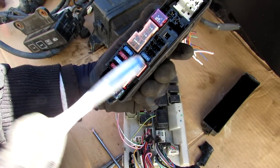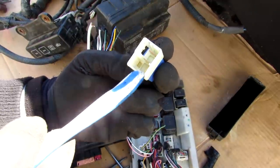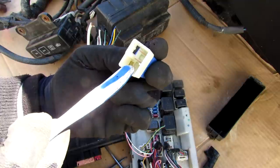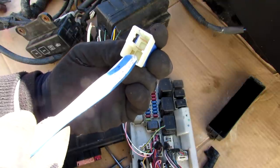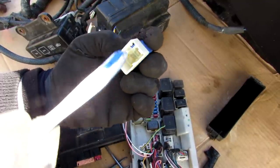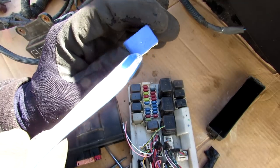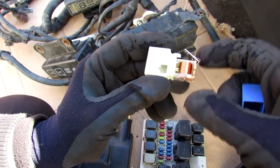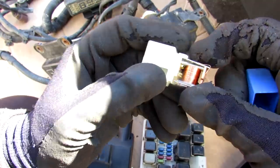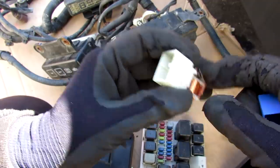Some of these could be automatic circuit breakers — if they warm up too much with heat they break the circuit, and when they cool down again they allow current to flow. What relays really do is separate a smaller amperage circuit from a larger amperage circuit. For example, if your ECU communicates in milliamps, it can apply 12 volts and a small amperage signal through a relay to bridge the gap and turn on your starter or light up a light bulb, physically separating the two circuits using an electromagnet inside.